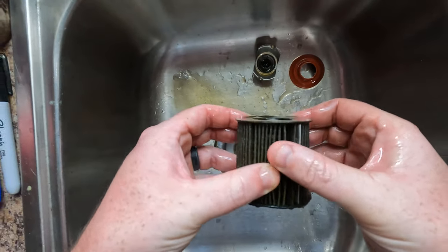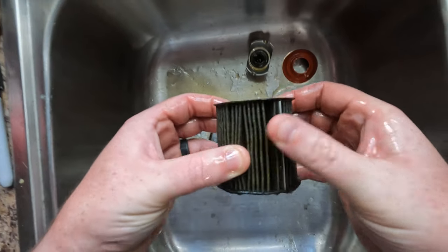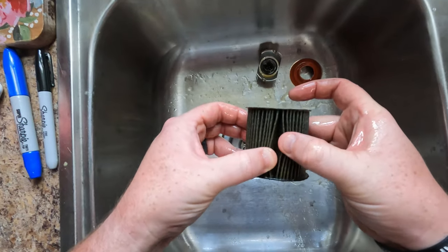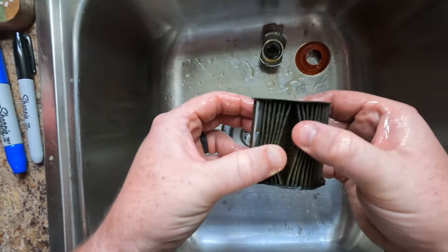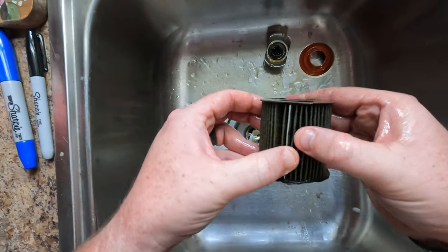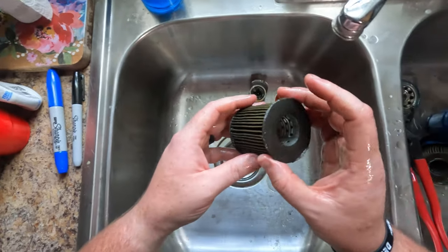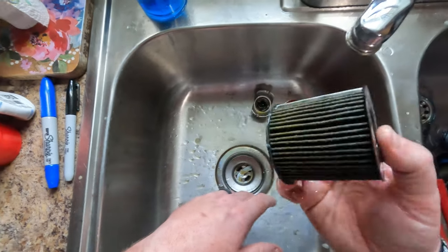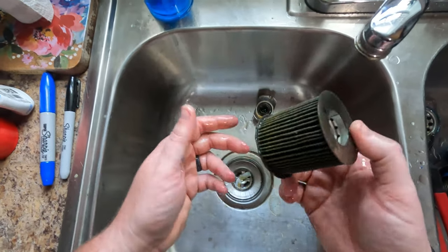Yeah, pretty clean. I'm gonna check each and every vane of this one, starting here. A little bit of debris there, nothing harming or damaging to the engine itself. A little bit of something there, nothing big. We're talking like, it's probably some silicone that I overshot or something. Good. I'm gonna call it, our engine's good to go. So we're good for the wide open pulls that we've already been doing for tuning purposes.